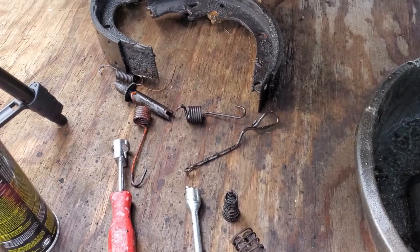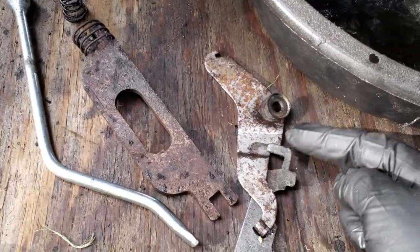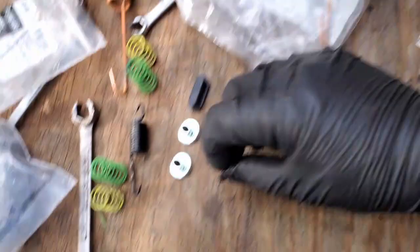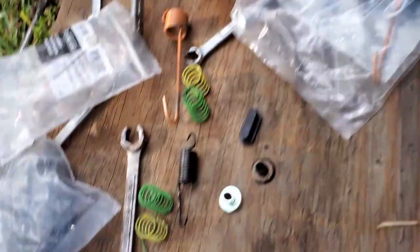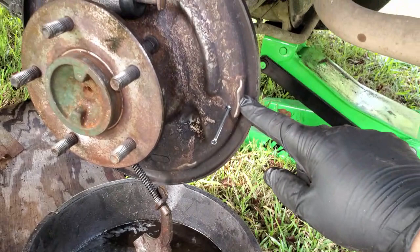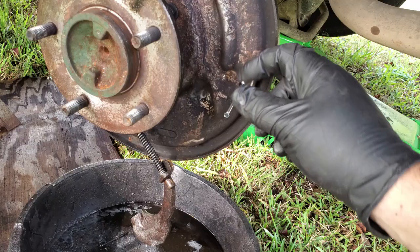This is where stuff starts getting a little crazy. Like I said earlier, take a picture beforehand because once you've got all the stuff laid out and it's been kicked around it does get a little more confusing. Be careful with these because everything comes apart literally, and once it does sometimes it gets confusing. We got a new one in our kit - looks the same, looks good. Something I learned today: these springs are different. The reason being is this one has more stuff on the side - it's got your e-brake lever and your brake pad - so it's gonna be a shorter spring because it's got more stuff in there.